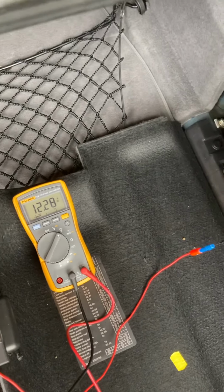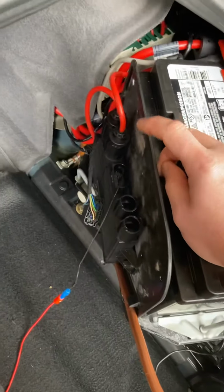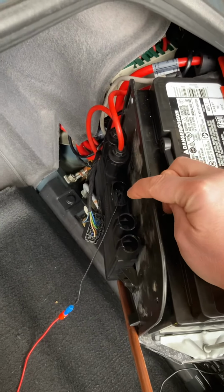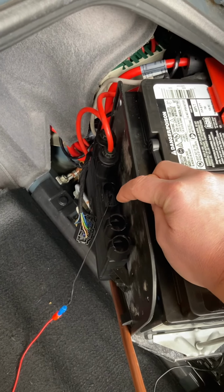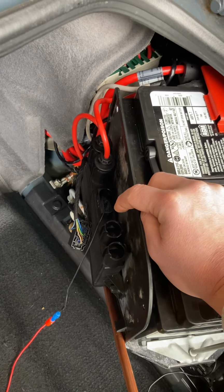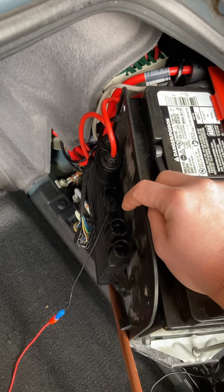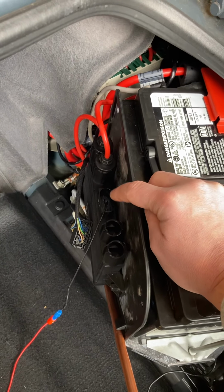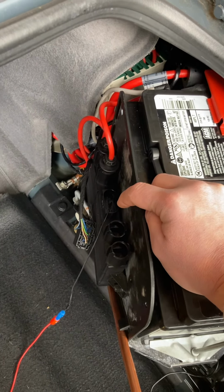So I'm looking for a little bit of help, maybe understanding from someone who might be a little more versed in electrical componentry than I am. But to me, this is an indication that this battery isolation switch itself is kaput, and there's something going on inside which allows the voltage from the battery to be fed to pin 4 directly.